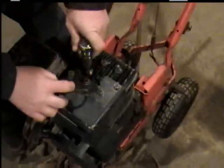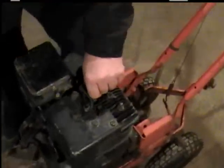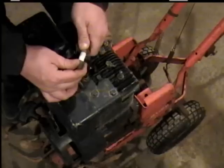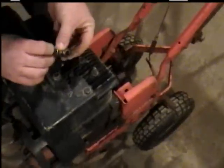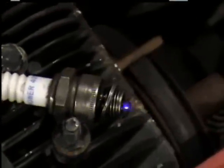By taking the spark plug out, then put it in the spark plug up next to some ground like that. Then you just pull on it and see if your spark plug fires — like so. It could jump down at the end, but it could actually jump over where it's grounded too. And again I'll turn the lights out a little where you can see that.